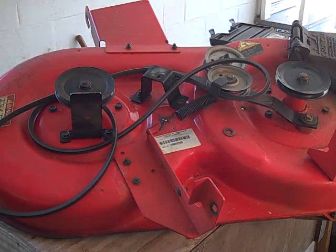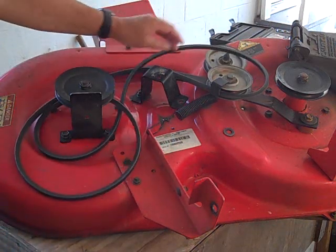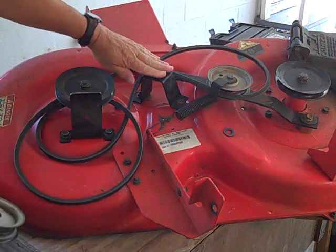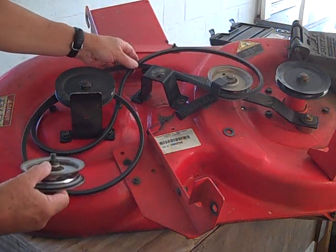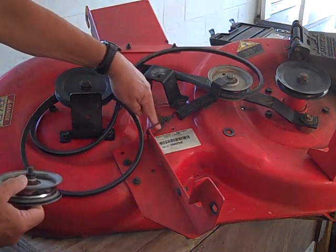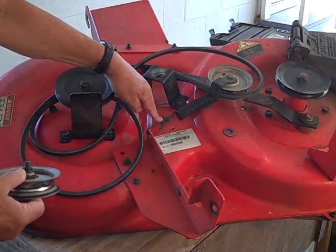We've actually done this before on another spot on this particular lawnmower deck. What happened was that this idler wheel sitting up on this bracket was inclined and it was throwing the belt. So when I examined and removed it, I saw there's a large tear here around a square punched hole.